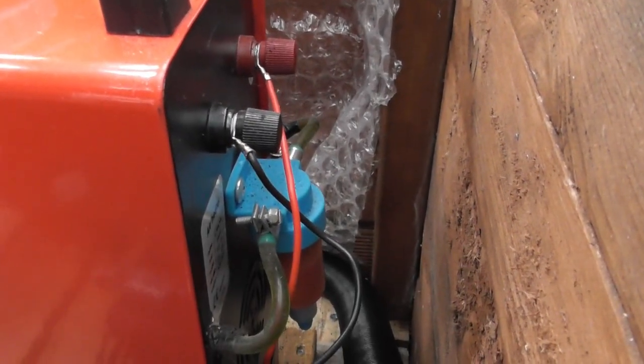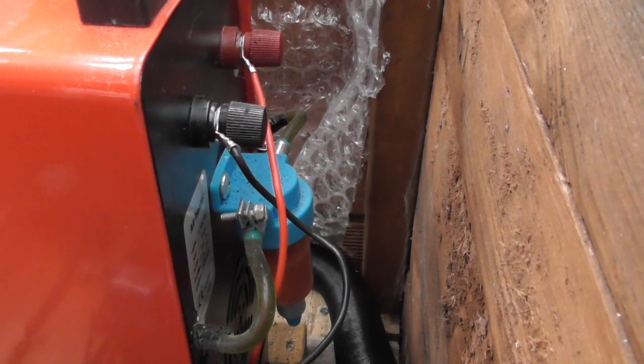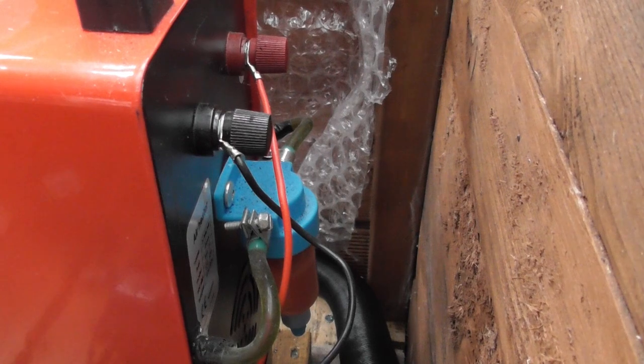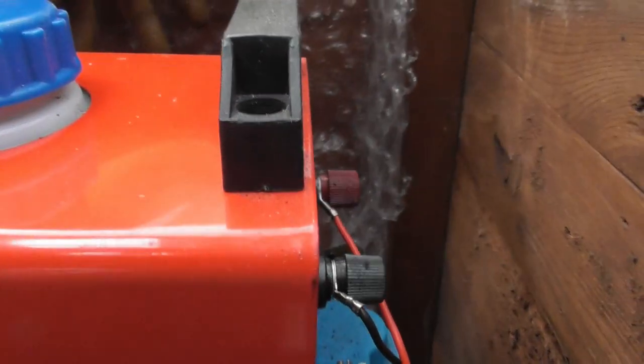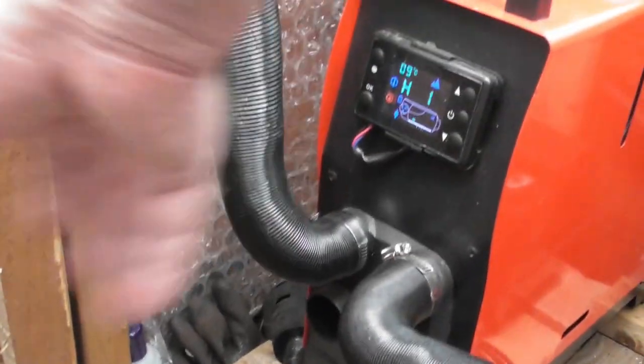As you can see that's the fuel pump and you can see that I'm using red diesel. As you can hear now the heater has got working properly, the pump is just clicking. That is the fuel filter — the pump is in there — nice and steady pump working and we've now got heat coming out of the tubes. You've no need to have these tubes on if you don't want; I've got one left on there just to project heat across that way.